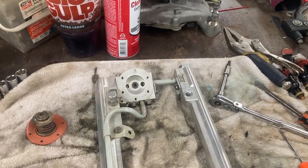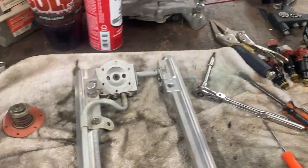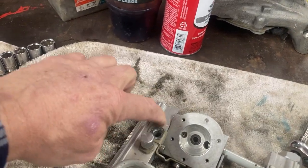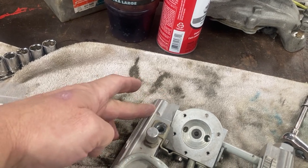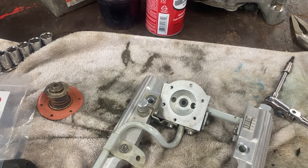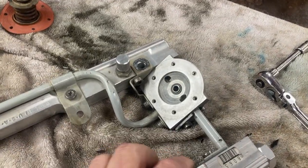On this particular rebuild, we just did the O-rings with this kit. One of the tricky spots was that tube that I always thought was part of the fuel rail — it actually has two O-rings in there. Be careful to make sure you do address that if you have any kind of leaks or sprays coming out of these rails.